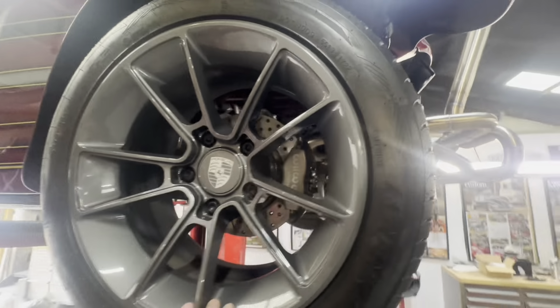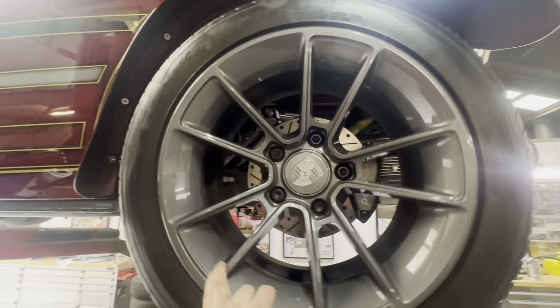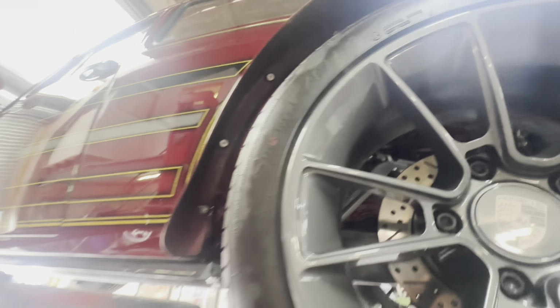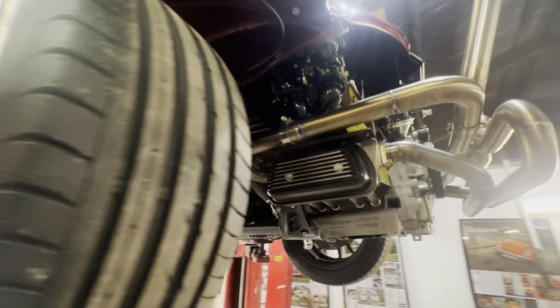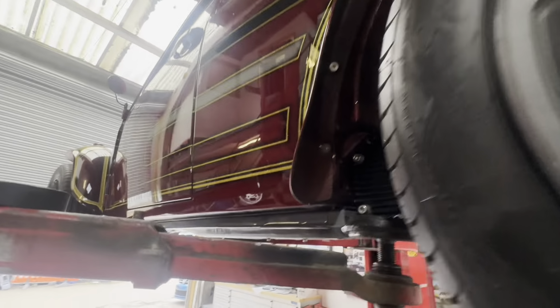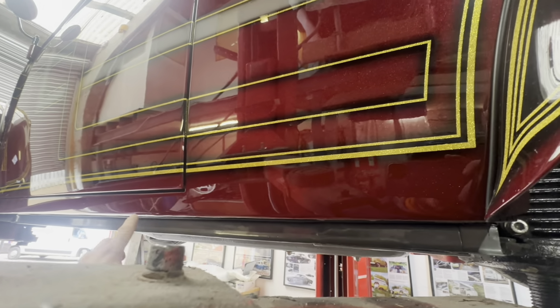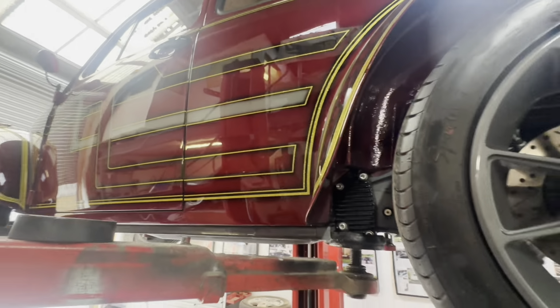And then yeah, our 17-inch GT3 style wheels on the back. All of the wheel bolts, the wing bolts are the countersunk M8s as well, with the special washers. Not an awful lot going on the underside. It's a relatively standardish kind of build for us on the underside. But something nice is we capped all of the heater channel off, so you get this nice clean transition through here instead of having the instep for the heater channel.